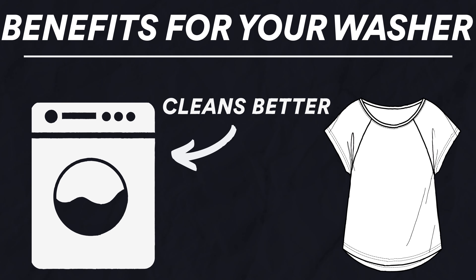That basically diminishes the life of your washing machine. It's always important to clean it — you need to do it about every 40 to 50 wash loads, because if not you're only diminishing your investment. Washing machines aren't cheap anymore. It's just better to do it for maintenance, for your own health, and for the longevity of the washing machine — and it'll save your nose every time you open it up.